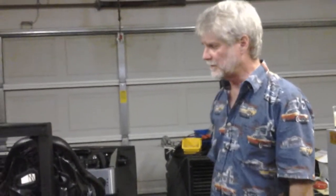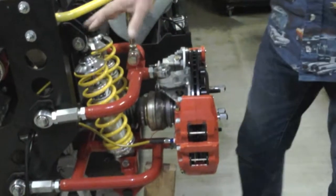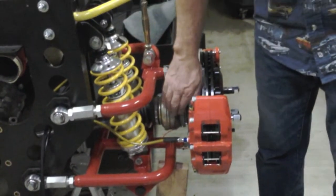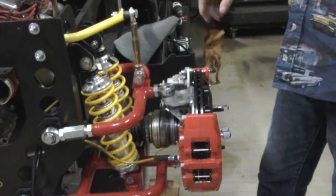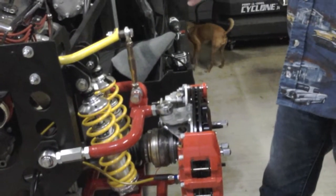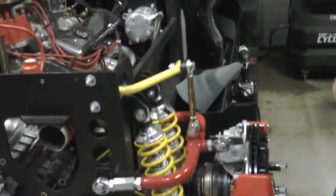See, we went into the cables, went into the brake lines. We're going to do a whole deal about A-arms, about A-arm geometry, about the axles, about the C5 versus C6 hub. If you go to a C6 hub, the industry standard has been the C5, which has got like 30 splines. C6 has got 29, whatever. And that couple of splines makes a big difference on what's available for axles. We're going to get extensively into that later.